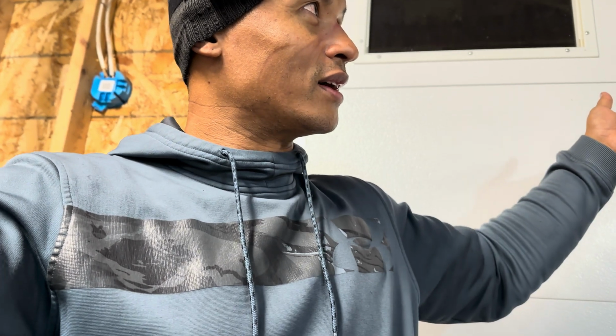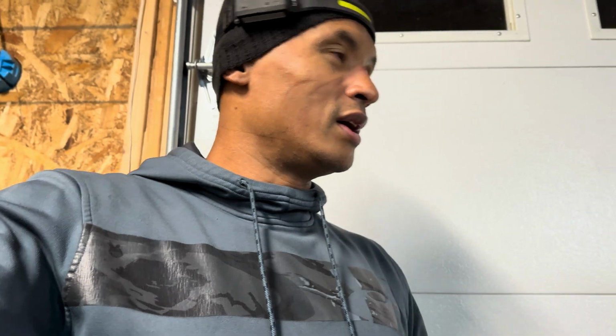Now, I know in a previous video I said that I didn't want to spray paint in here, but I had a good method that I used to get a lot of the overspray out. And since I was under the car, I didn't think it would come up from under the car and outside too much. What I did to remedy that is I used some old box fans that I had, and cracked the garage door open just enough so the air could go underneath, so there wouldn't be a whole lot of other wind stirring up the overspray.